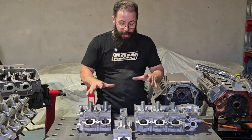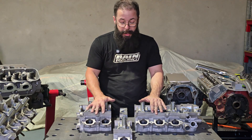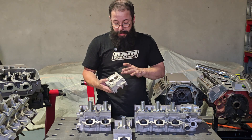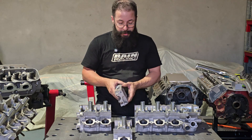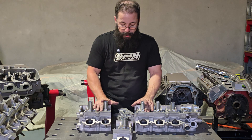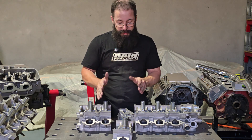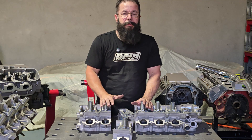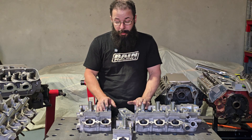We're going to map the CSA, see where it's actually at as far as RPM goes for this build, then go from there and work out what areas we really need to address. We'll study the castings and see what's possible — how we're actually going to fit the CSA we need into this cylinder head without getting to the 40th hour and finding water. We want to make sure we have enough thickness, especially in the exhaust ports. You see a lot of the guys with RBs, the new cast replacements — they pretty much can't port them because they're blowing through the wall even in a factory head.